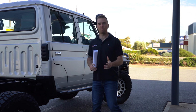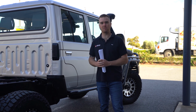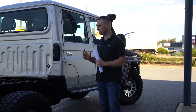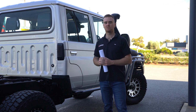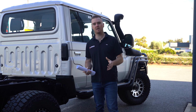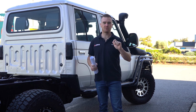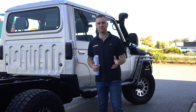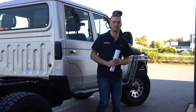With the Jmacx 4495, we've got a couple of different shock options depending on what you're looking for and what the budget allows. On this one, Simon's gone for the Jmacx Alpha with the manual adjust. So they're remote res, 2.5-inch shock, manufactured by Jmacx. They've got a fantastic warranty, they're really user friendly, and they've got that manual adjustment so you can fine tune the ride comfort to suit your needs. Let's go up the front and have a look at the bar work.